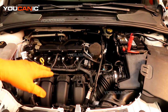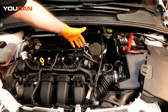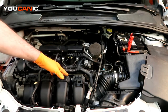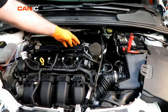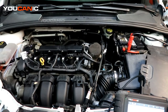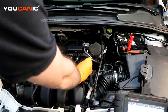On this vehicle, because it's a four-cylinder, there is only one bank. Sensor A is generally on the intake side and sensor B is on the exhaust side of the cams, because you have dual overhead cams. We have sensor A throwing the code, which is the intake side.